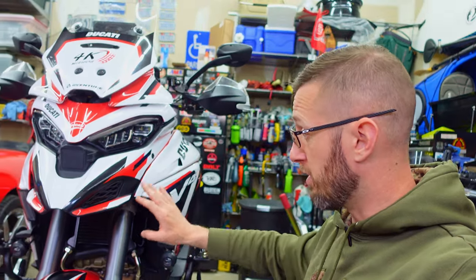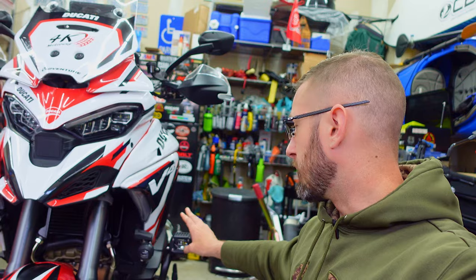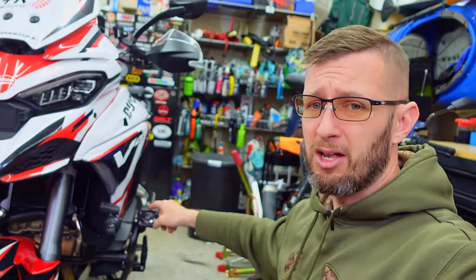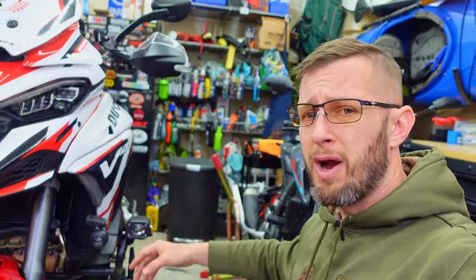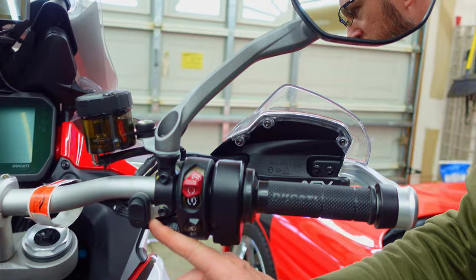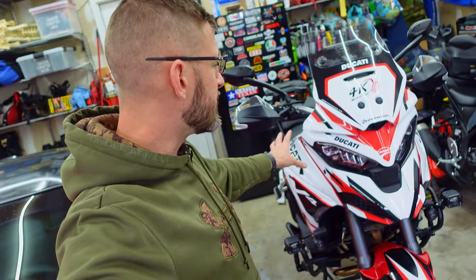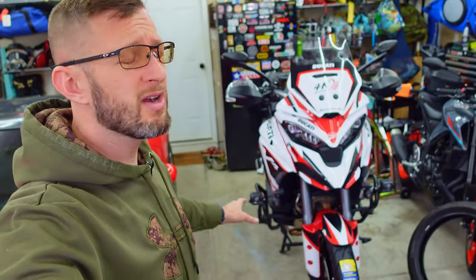I am very happy now with the lighting output of this bike. I don't get many people flashing their high beams at me, so I don't think they're blinding in any way — they just make the bike more visible and provide a lot more usable light. I would highly recommend these things; I'll leave a link in the description below. Again, less than $100 — they come with a full wiring harness, relays, and a switch. This switch mounts to a bolt hole pretty easily, comes with that bracket, and remains in one position or the other, which I like. Wire the relay to an ignition-based power source so it only comes on when the bike comes on. I do have some friends with ClearWater lights and the Denali lights that are wired into the bike and can vary brightness based on high beam or low beam and do turn signal switchback stuff — that's all cool — but for the price of these things and how foolproof they are, I am very happy with them.